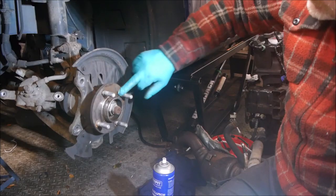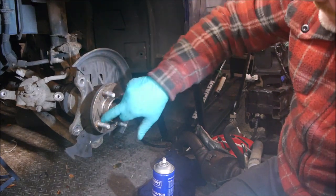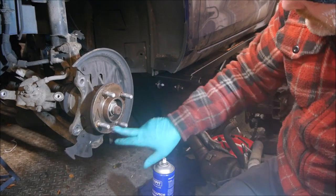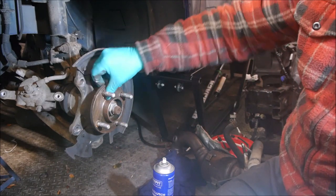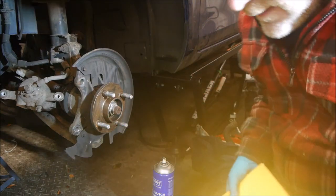Because this is metal on metal, it's advisable to put a smidge of copper slip on here — just so when you come to take it off next time it hasn't rusted on — especially around the hub area. That's the main bit to do. You don't need a lot of grease on it.